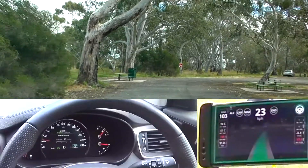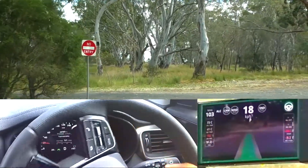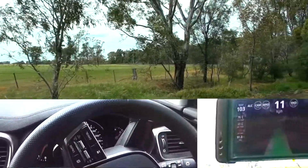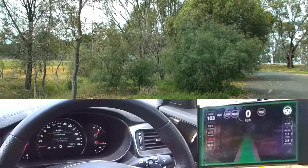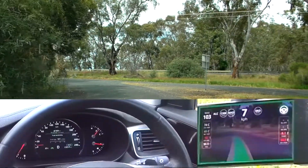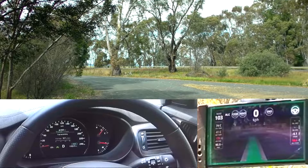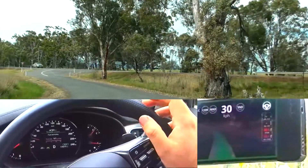Now OpenPilot is steering and it doesn't really know where it's going to drive me around the parking area. At 16 kilometers an hour, OpenPilot still has control of the steering wheel. I'll bring us down to a total stop - once we come to a dead stop it disables torque. The moment I start driving again it's in again. So it's only when we come to a standstill that it actually disables the torque. At lower speeds its maximum torque is actually really weak.